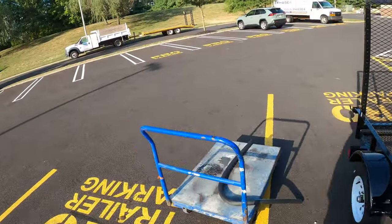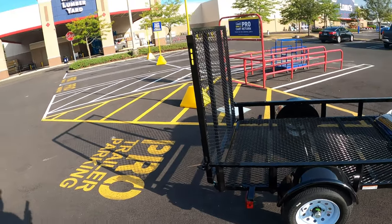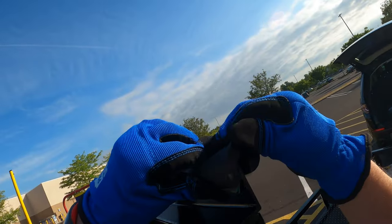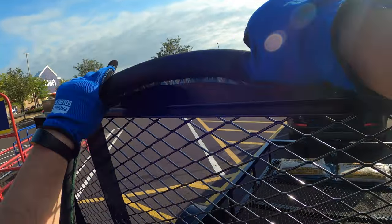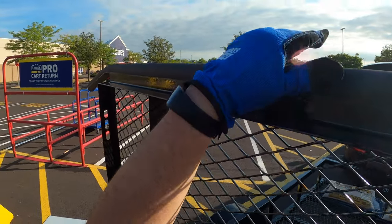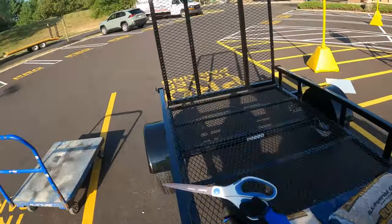The second thing we're going to do is fold in the tailgate. I could just remove it, which removes all that weight from the back, but another option is to fold it back down. The problem is metal riding on metal for about 40 miles is going to add wear. A simple solution: I ran over to Lowe's and picked up self-adhesive rubber pipe insulation — the rubber kind, not foam, which is a bit more durable. I'm going to fit that over the contact points so when it folds in it doesn't touch the bare metal.